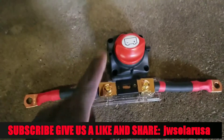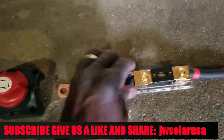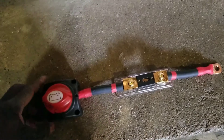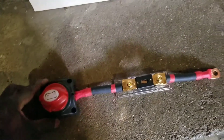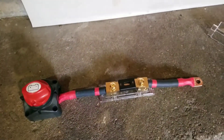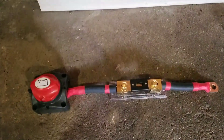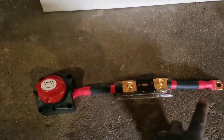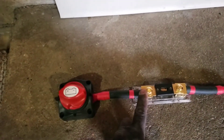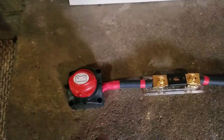I'm going to incorporate a battery disconnect that goes on the other side of the fuse block to give me a complete shutdown of the battery bank. It connects like this — the other side goes into the bus bar where you feed the power. If you don't have a bus bar, you connect your batteries directly from the positive battery terminal all the way to the fuse.